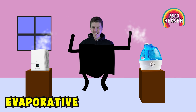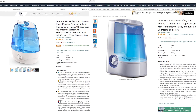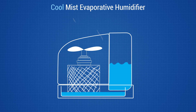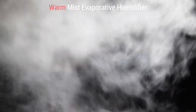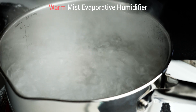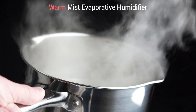That is evaporative humidifiers and ultrasonic humidifiers. Evaporative humidifiers fall into one of two categories: cool mist and warm mist. Cool mist humidifiers rely on air that is blown over a water-saturated wick to evaporate the water into the air. This wet wick can harbor bacteria and fungus if not cared for properly. Warm mist humidifiers use a familiar technique of boiling water, the same method used to distill water, and therefore has the least potential to release bad substances into the air.